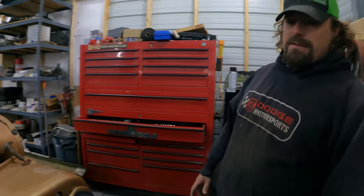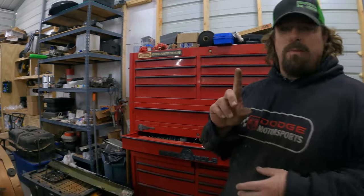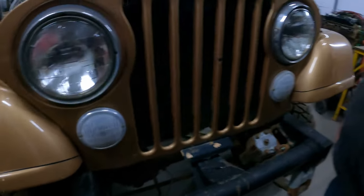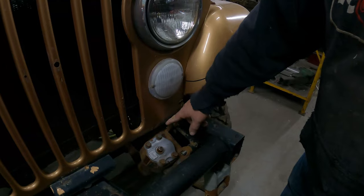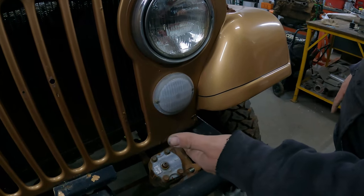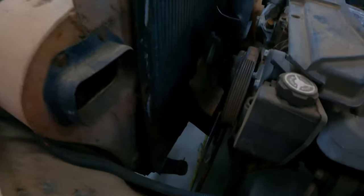It's on. Kinda. So we still are not completely tight down here. That's problem one. It's hitting the frame here. That's problem two. But those are minor compared to the steering gear box is hitting the grill. And even that is relatively minor because we could just notch the grill out, compared to the fact that the radiator is covering the input on the steering gear box.